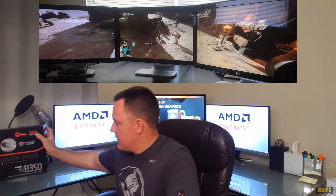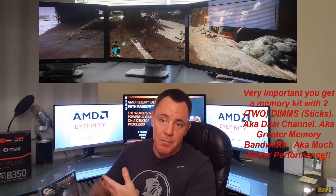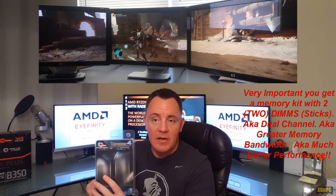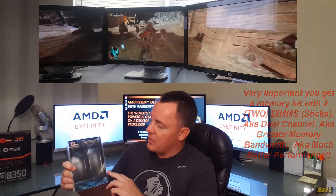And of course you're using system memory. The system memory I used — again recommended by Steve over at Hardware Unboxed — is only an eight-gigabyte kit, two times four. He does have four slots on that board, so you can always toss in another eight or sixteen gigs. This is 3,000 megahertz, and this RipJaws 4 GSkill memory looks identical to the GSkill Flare X cosmetically. I think it actually is Samsung B-die memory — it's rated at 3,000 megahertz.